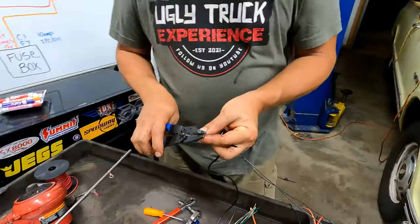Oh, it looks solid to me. Okay, so all right, the last wire is the wire that comes from the check engine light, and it goes to the PCM. In the wiring diagram, it's a brown wire with a white stripe. It goes to this connector, like I just said. And then from here, it goes down to the PCM, and the PCM is what grounds that wire.